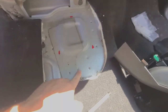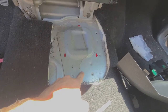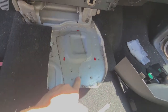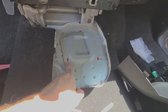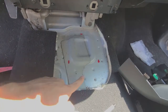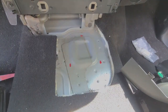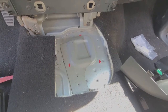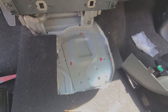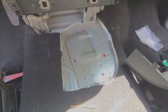that the hole doesn't extend past the center line of this divot right here, which leaves just a little bit of meat for these 2 holes. So what I'm gonna do is drill these 3 spots, I guess. Well, 4, I'll just rough that one in. I'm gonna do that just enough to where I can set it down, so that just the feet push down, and then I can hopefully set that boot on there flat. So let's start cutting some metal.